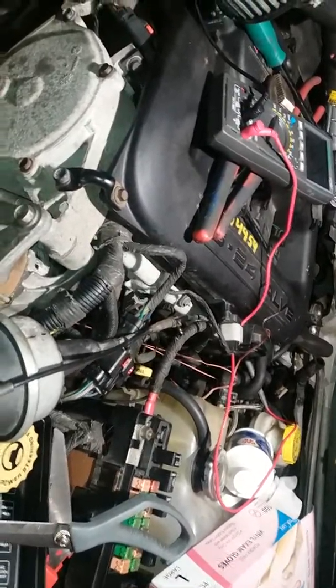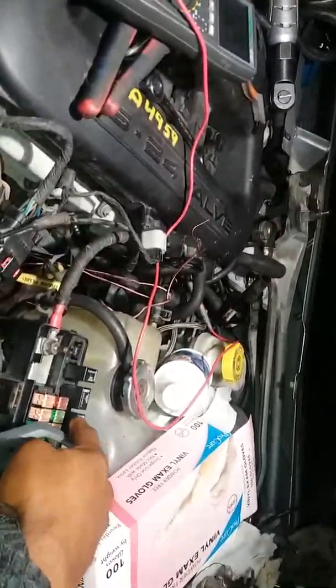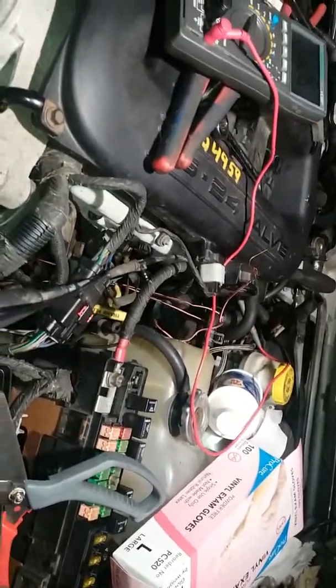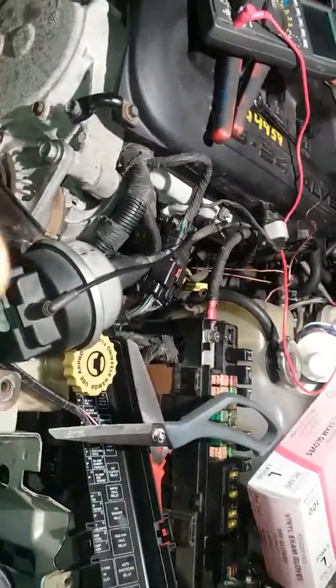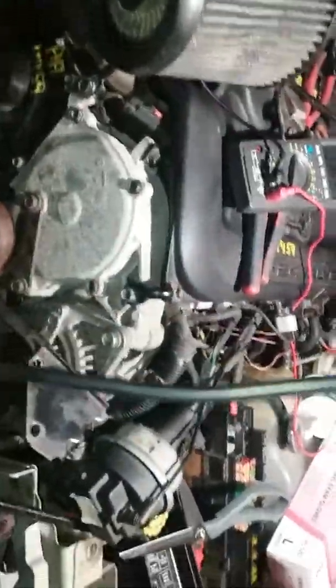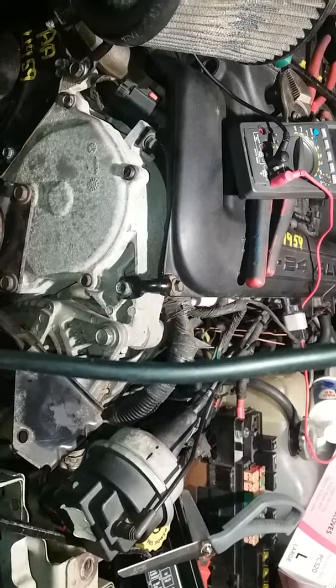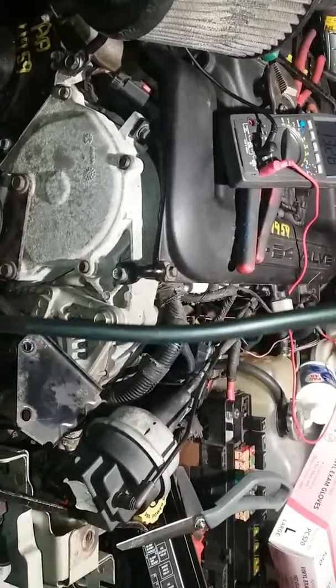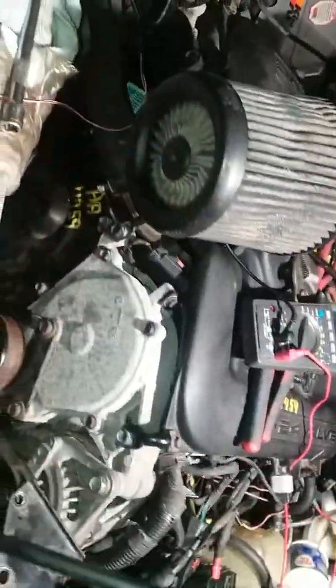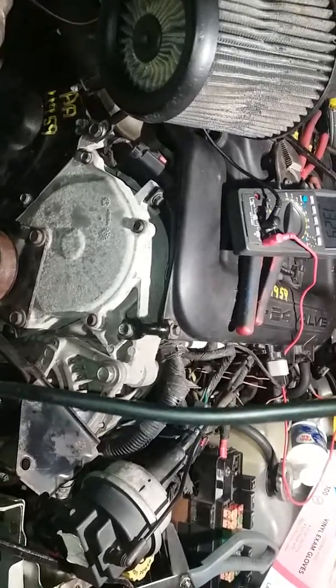There's no click from the starter like before — my black car the starter would click but just wouldn't start. This time it won't even do anything. I even tried to jump the relay from the box, still nothing, which I find very weird because with the last problem I was able to jump the relay and get it to click. I'm hoping the starter is bad, but it's weird — why would it just crank twice? This is the starter that came with the engine, a 44,000-mile engine. Why would it be going bad already?